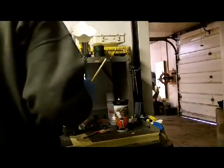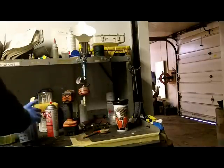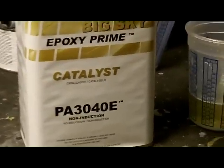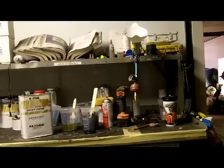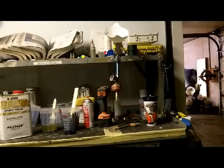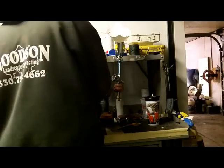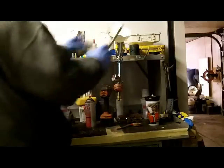And this is a one-to-one mix, and it is a... almost lost it there. You can read that right there. Non-induction, so there's no induction time on this particular epoxy. Some epoxies have an induction time of 30 minutes or something like that. This one has zero. I've been using it for a while. I don't know that it's the greatest stuff since sliced bread, but it seems to do the job, so...